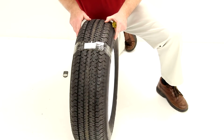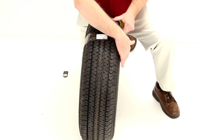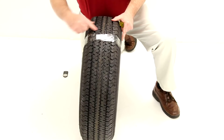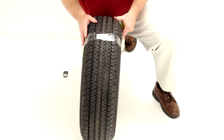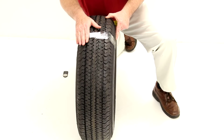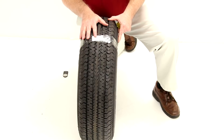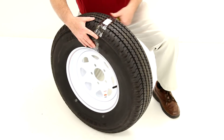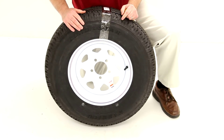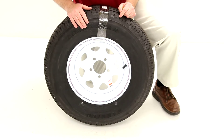This is a radially constructed tire, meaning the belts or cords on the inside run bead seat to bead seat along the radius of the tire. This gives a better contact patch due to the flex of the tire, resulting in better stability and better traction. Another advantage of a radial tire compared to a bias tire is that it normally runs cooler, as long as it's not overloaded, and when a tire runs cooler it tends to last longer.